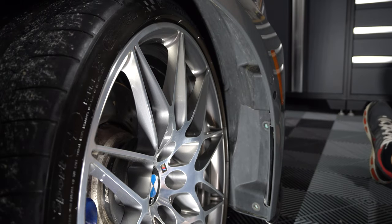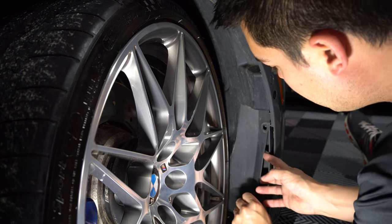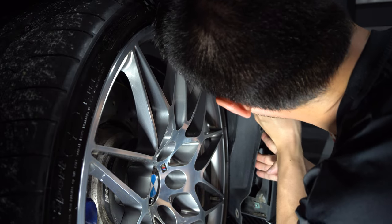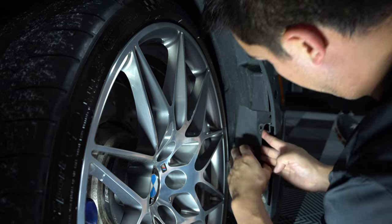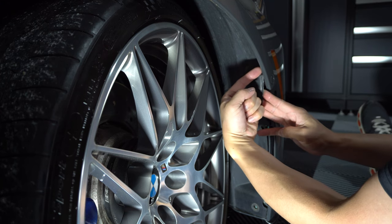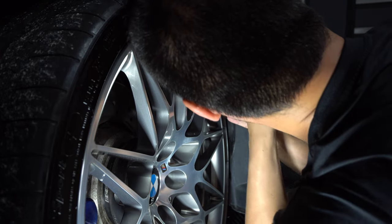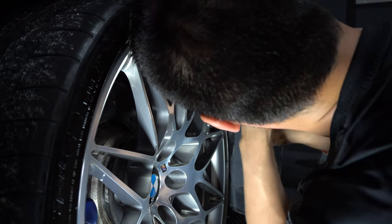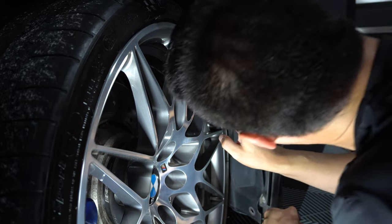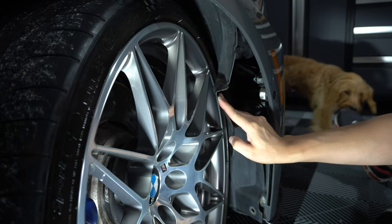So we've got those three off. Now just pull this back with your hand. There is a little tab right here on the bumper to be mindful of when pulling this out, especially if you have those sensors. And just like that — here are your parking distance control sensors as well as the cameras. Directly behind it, we should be able to access the reflector itself.